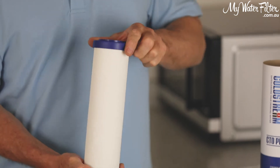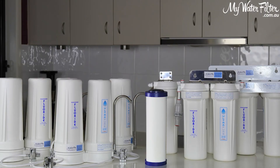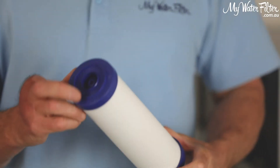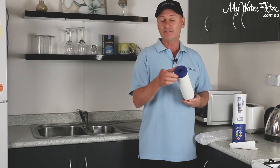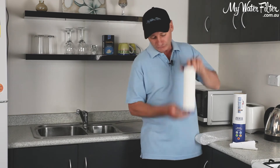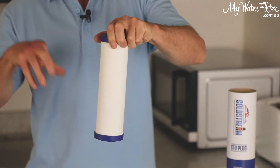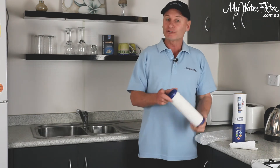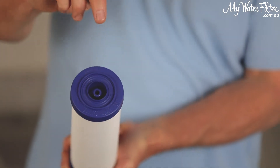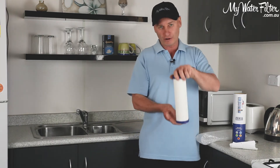As you can see, it's just a beautiful looking cartridge. We use this in our UltraPure systems as well, because it's such good quality and the test results are fantastic. It only has a hole in one end. So if you're putting this cartridge into a benchtop water filter, make sure that the hole goes down, because the water penetrates through the side and comes out the hole going down and out. If it's under sink, then it goes this way up — it does say 'this way up' on the cartridge. Benchtop will be the other way.